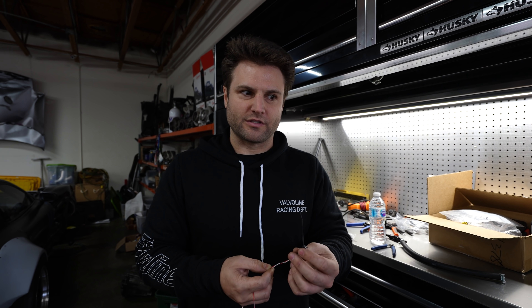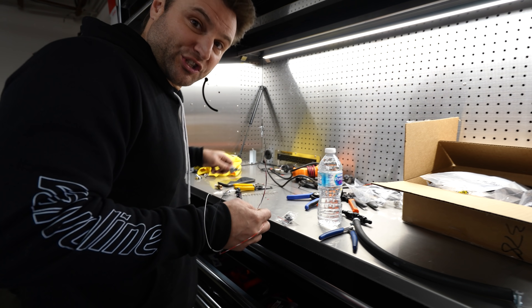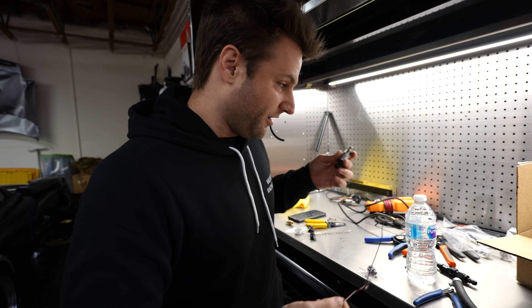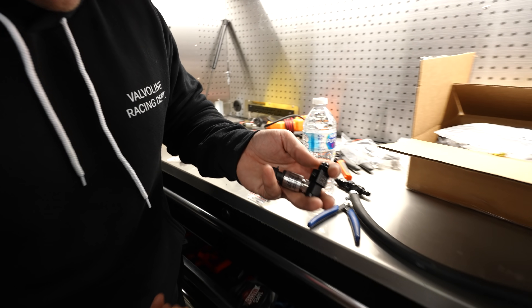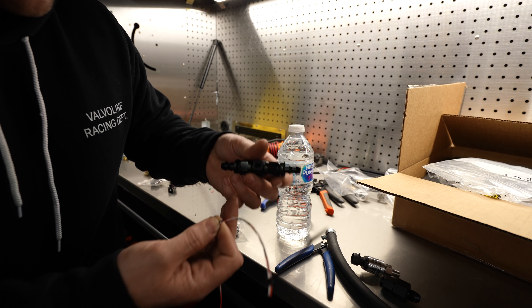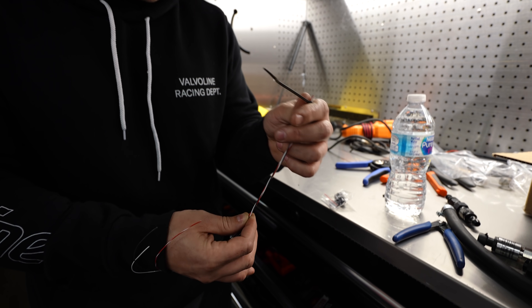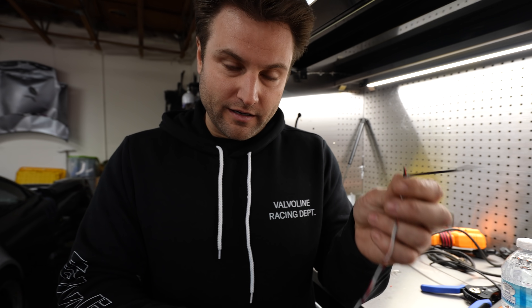It's kind of fun for me to come back to stuff like this because you remember how scary it is to start modifying your car. For example, we're dealing with how to tap in a fuel pressure sensor — whereas on this channel, this is not even something we would film. But on a stock car you're like, well, can I use this piece? Will it fit? That's AN lines — well, the stock car doesn't have AN lines. What's the cheapest way to do it? And you forget how sensitive a stock car is and how scary it is to start modifying, including the wiring. I've long since only been dealing with my own wiring. In this case, we're actually dealing with a stock harness that we are tapping into, and that introduces so many more uncertainties — you're assuming a lot.